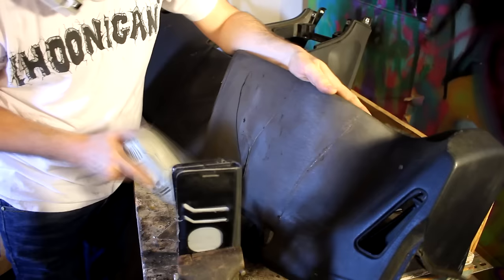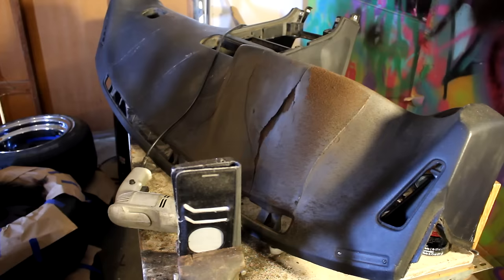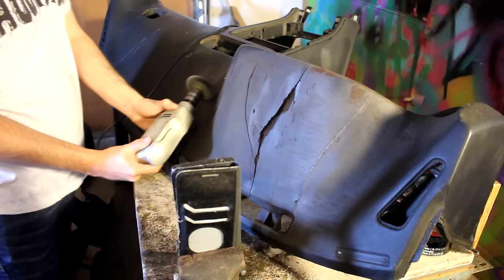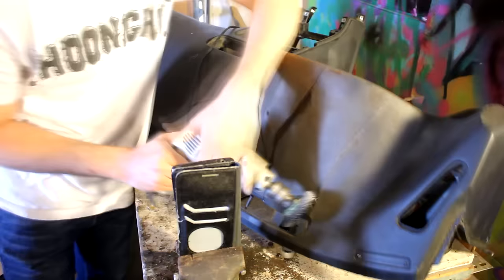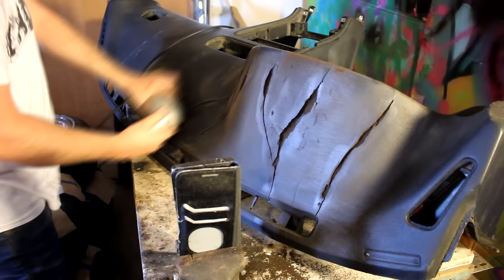To start off fixing my dashboard, I took a wire attachment on my drill and tried to dig out the cracks as best I could. The reason why is because when it cracks, it has a level surface, then where the crack starts it bumps up, dips down where the crack is, then bumps back up and levels out again. So if you just dig out the whole crack, you have a big hole. If you fill that up with Bondo and do a good job, it will be a perfectly level surface. So that's what I did.